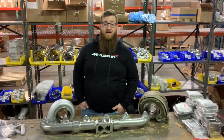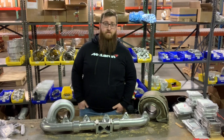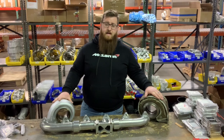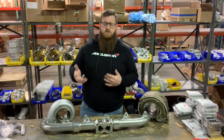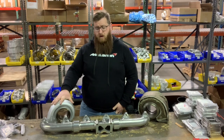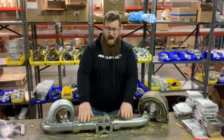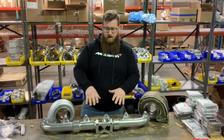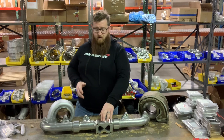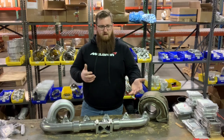Now we know that hotter exhaust gases move faster. So how are we going to take advantage of that to get the performance and efficiency benefit? We're going to have to do something to keep the heat in there — either ceramic coat or a blanket. Your exhaust gases are made in the combustion chamber, come out through your exhaust manifold, and empty into your turbo. You can ceramic coat your manifold, your housing, or you could use a blanket. What I have here is a manifold from Full Tilt Performance — they do ceramic coating on their manifolds from the factory. Aside from looking sweet with this nice chrome finish, it's going to give you that heat benefit for better spool up, which equals more power and efficiency.